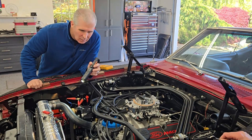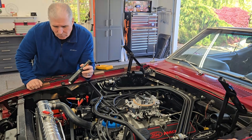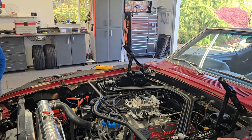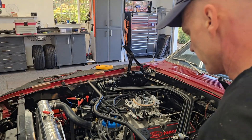Okay, for the camera — we don't know what the timing is of course, but the first start seems to be okay. Oil pressure is about 60 pounds on a standard volume oil pump. Temperature is about 180. The sensor is right here and it's decoded digital — so we're just looking for leaks now.